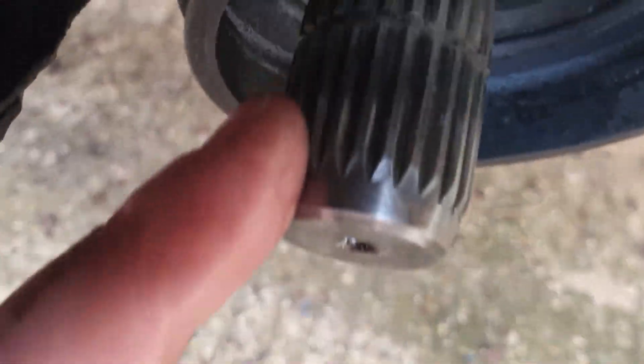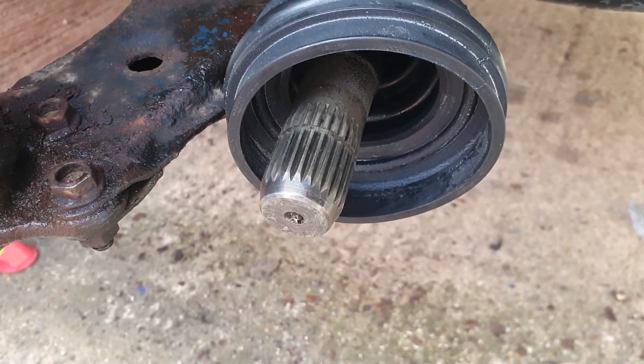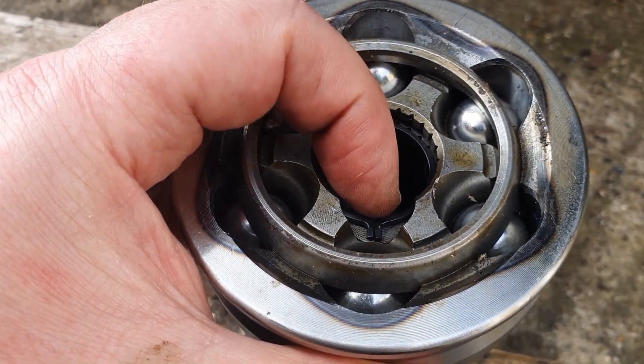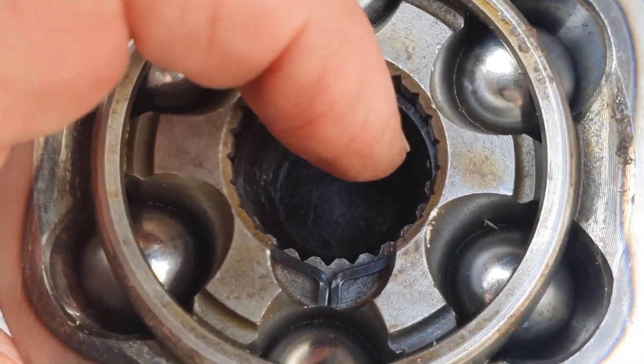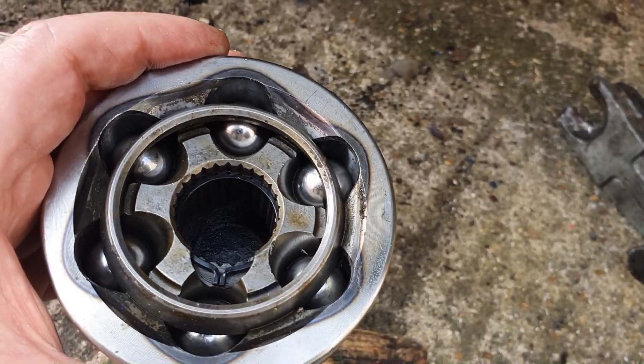I'll quickly show you where I've got to — two new boots on. Getting this end here over the splines was a bit of a pain, so I just squirted a bit of WD-40, then wiped that out with some paper towel. You can see the new circlip in there clearly now. When you get this on center and it lines up with the splines, that should just push the circlip open until it reaches the groove in the shaft and then clip into place — then you know it's fully home. Let's get that greased up and on.